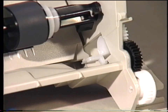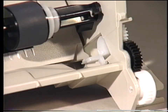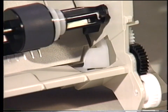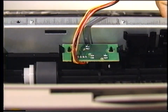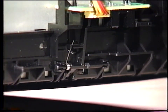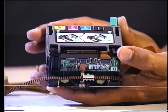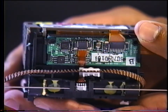When in the rear plain paper position, the corner arm moves forward so the paper stacks upon it to ensure only one sheet is fed at a time. When the paper selector lever is in the envelope or thick paper position, the corner arm gets tucked away so thicker stock can easily leave the feeder. The pickup rollers turn one revolution to feed a sheet of paper and then reset the cam to hold down the lifting plate at the end of the paper feeding cycle. As the pickup roller turns to feed paper, the flag on the roller shaft actuates the pickup roller sensor mounted on this circuit board. Also on this board is the paper sensor — as the paper enters the printer, it contacts the sensor's arm, which actuates the paper sensor. There is also an internal temperature sensor, which consists of a thermistor mounted on the carriage PCB, detecting all internal temperature information of the printer.